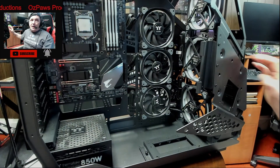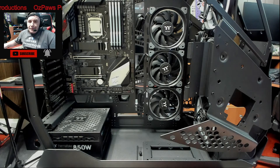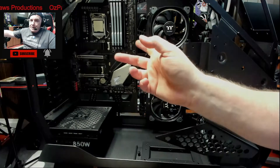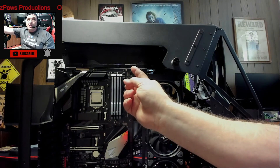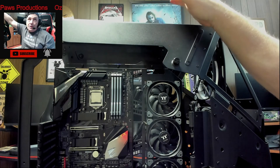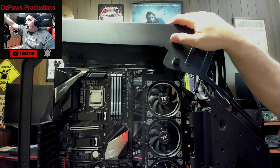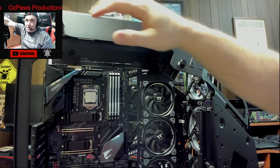So remember our next video, video 10, will be installing that AIO all-in-one cooling system. That's going to be kind of a challenge because you kind of have to have four hands to do it — but you can get around that. First thing we're probably going to do is assemble the AIO — attach the fans to the radiator first. Then we'll lift the radiator and fan assembly up into the case from the inside, install it in through the right side of the case, and the screws will come down through the holes in the top of the case into the radiator to hold it securely in place. Then there's a big grill assembly that goes on top of this case.